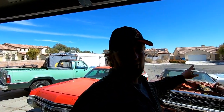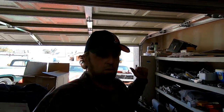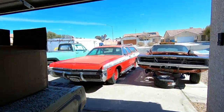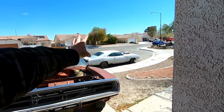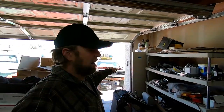Put the slicks under it, see what it runs, and then that same night, we're gonna yank that 293 out and throw a 391 in it and see what it runs. Just as a comparison between a full 1-point ratio gear difference between 293s and 391s, same night, see how much of a difference that makes on that car. Because those 293s, that's really lugging the car down a lot. But it still ran a 12.73 at 5,000 foot with those tires.